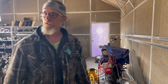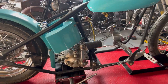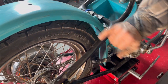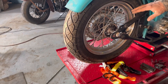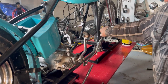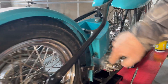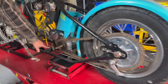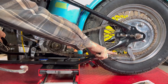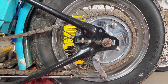There's been a lot going on here. Here's our Knuckle - she made it to the lift. What we're going to start doing is pull this oil bag and fender that I just have finger tight on there. I'm going to pull this rear wheel off and I'm still not sure if I'm going to run this star hub wheel with the mechanical brake setup. This is all mechanical arms - this shaft turns, there's a rod on the other side, that rod connects through here and turns down so when you hit the brakes that's what stops you.